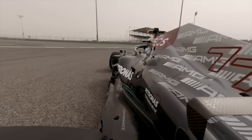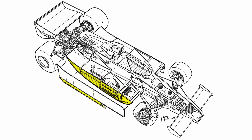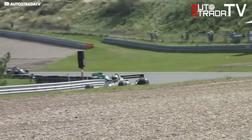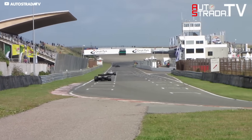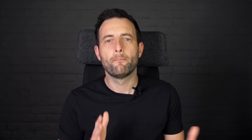This means you can ultimately run the car with a lower ride height. The main reason F1 cars run so low is all to do with aerodynamics. In the late 1970s, F1 was all about ground effects — working the underside of the car to create a low pressure zone that sucked the car into the tarmac. Lotus achieved this with a genius side pod design that had an internal venturi shape that ended at the diffuser. This specific shape accelerated the airflow under the car and created a low pressure zone, thanks to the principle that as airspeed increases, pressure decreases. The cars used skirts at the side of the bodywork which sealed off the air underneath the car to maximise the low pressure effect. Since the air couldn't escape out of the sides, it was forcibly accelerated underneath the car, creating massive downforce with minimal drag.